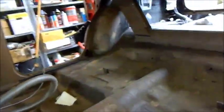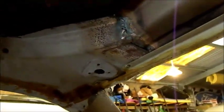Now, on the underside, I reckon this has had a new turret, new roof skin put onto it. There's no consistency in terms of colour from the factory where the car was painted, but not just that, it's my opinion that it's had an accident. Now, there's no damage on the pillars, on the side of the car, nothing. But this has been creased and straightened out, and also it's freshly welded there and there. Now that looks to me like a tree or something has fallen on it.